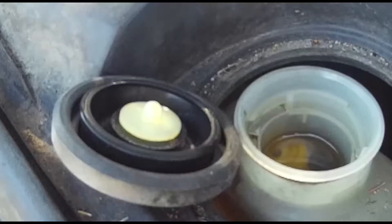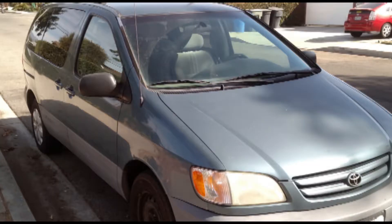Notice that the brake fluid level is back to full — looks like we don't need to add any. Close it up, put away your tools, and you're done. I should point out that it takes more tightening of the wheel nuts to be sure than I showed here, and I recommend checking them again in a few days to be certain.